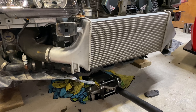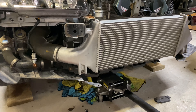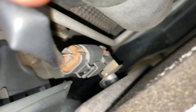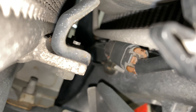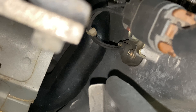Now we're going to go ahead and change the intake temperature sensor on the front mount intercooler, and we're going to show you where it's located. Up in here — right there — that little plug, that is your air intake temperature sensor. As you can see if you go in right there, the little wires, there's two bolts right there. That's what we have to unscrew and put the new sensor in.